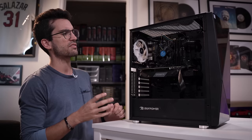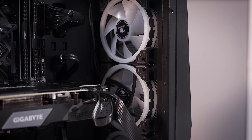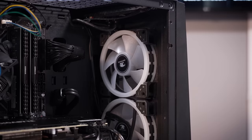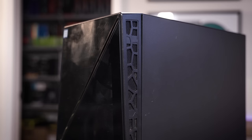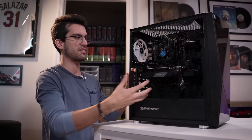I also noticed up front he has three fans but only two of them are set to intake, and then the one up top is set to exhaust. I assume the owner thought two intakes and two exhausts would be more beneficial, but I'd recommend — especially given this case has a pretty restricted front panel — swapping that front fan to intake so you have three intakes working hard to get fresh air in and just one exhaust, with passive exhaust elsewhere including up top.